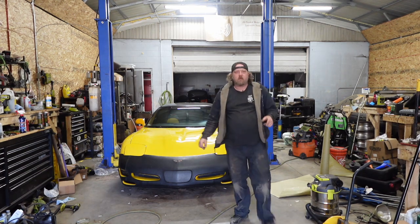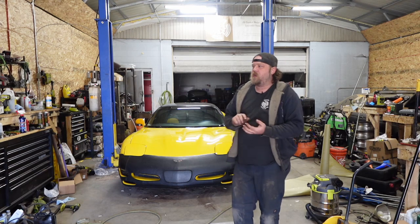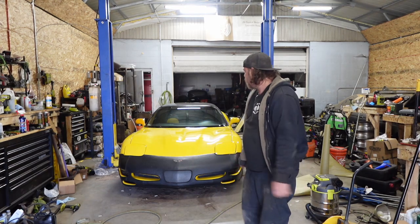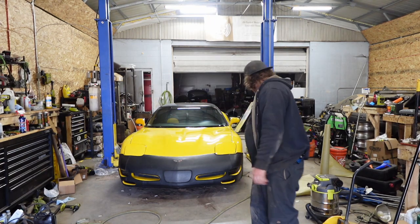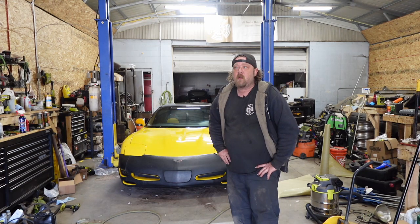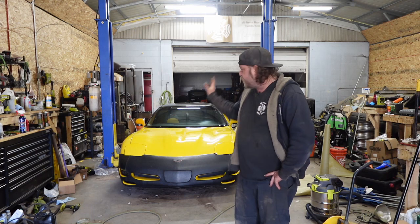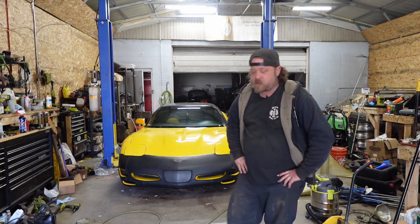And what I was gonna say is, yeah, the bell housing's still wet, or it's moist, for lack of better terms. I haven't checked that side yet, but that side is. But nothing is hitting the ground. And you know what, my entire fleet is GM, as far as my daily driver, so on and so forth. As long as the oil doesn't touch the ground, I am fine with it. And also, it doesn't smell like burning oil in the car, so I think something got slowed down.